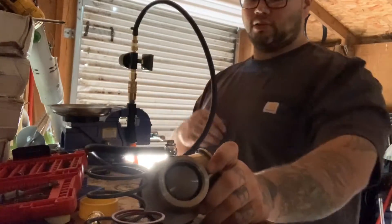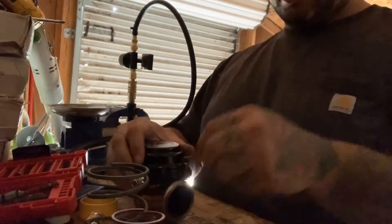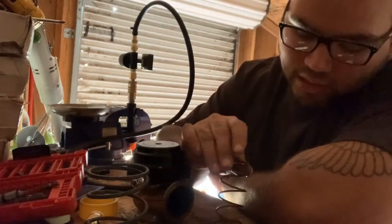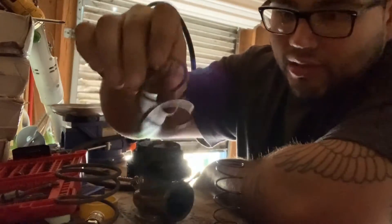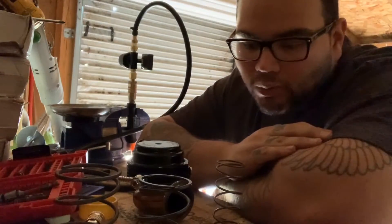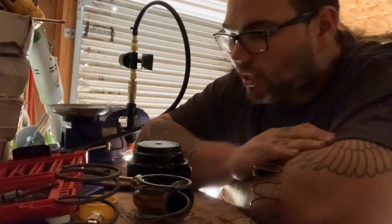So I think it's safe to say the red spring by itself is the closest to 8 psi out of all of them. I would say this original spring is probably your 14 psi spring. The plain black one was opening up at about 10 psi - call it a 10 or 11 psi spring. The red one was the closest one opening up at about 8 psi. I guess it pays to test your gates, just to make sure and double check everything. On the car with the original spring I was making close to 12 pounds of boost, highest was 12.7.